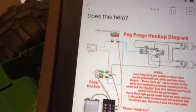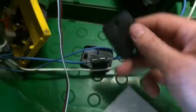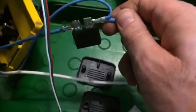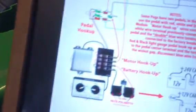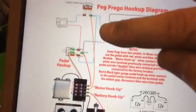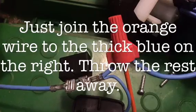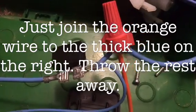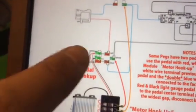I was trying to figure out what the thermal protector was. It turns out if you follow the wiring and pull up this little section of floor, inside is what looks like a connector with wires coming through it. You just pop it open and this little thing is the thermal protector. I'm going to hook the orange wire up to it as per the diagram. The connector wasn't really going to play ball with the orange wire, so I just spliced it in.